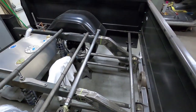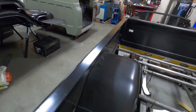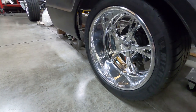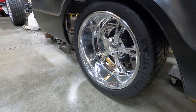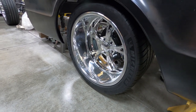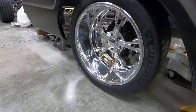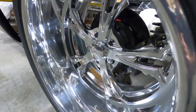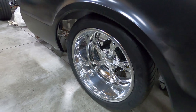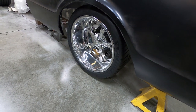The biggest thing you might have already noticed is the wheels. He finally got a set — these are US Mags billet wheels, the Cartel 5. The rears are a deep-dish 20x12 with a 4.5-inch backspace, running the standard Chevy lug pattern of 5 on 4¾. He's got 345/30/20 tires — Michelin Pilot Sports.